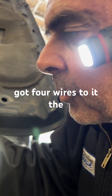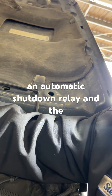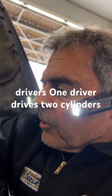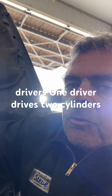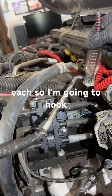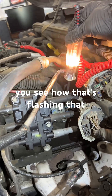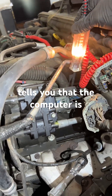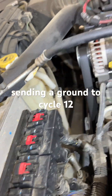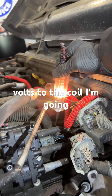There are wires here — the brown wire in this case is the automatic shutdown relay, and the other three wires are separate drivers. This coil has three separate drivers; one driver drives two cylinders each. Hook up to one of the wires and you can see how that's flashing.